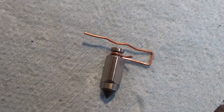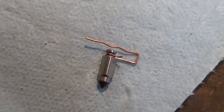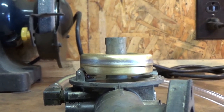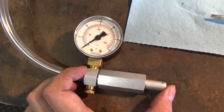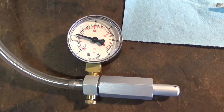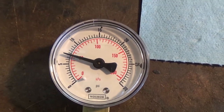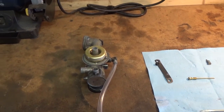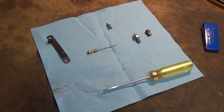Being able to grab the right part from my parts drawer is one of the best things ever. We've got a new needle valve with a rubber tip and a new clip — I saved the old clip and put it back in the bag. Make sure the float is level — not too high, not too low. With the new needle valve installed, I pumped it up and it's holding well above 5 psi immediately. That's what new parts do for you. The carburetor is sealed and ready to go back together.